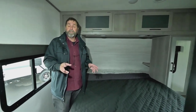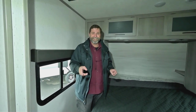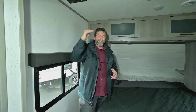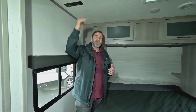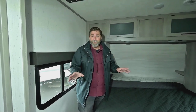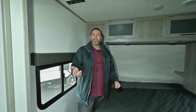That's a quick look at the 2022 Kodiak 261RBSL and I like this trailer a lot. One other thing: it has a solid core roof and a solid core floor. That means it's very unlikely to get water damage in the roof and floor because there's no wood in them — they're made out of block polystyrene foam. They're very strong, very warm, and not biodegradable like a normal trailer, and that's something I really like about the Kodiak.